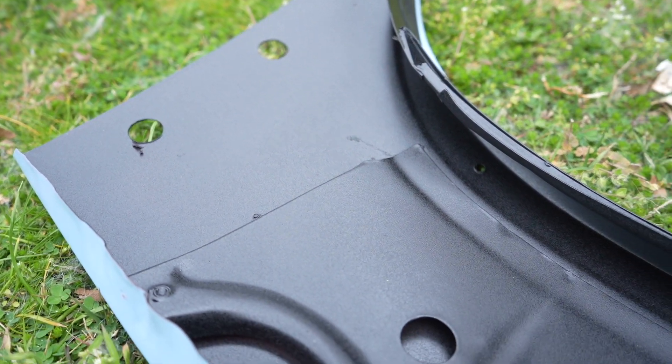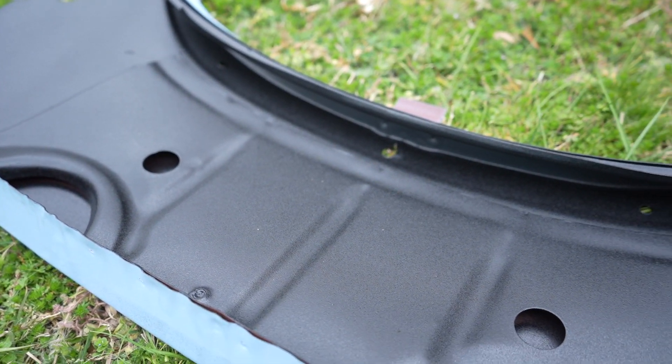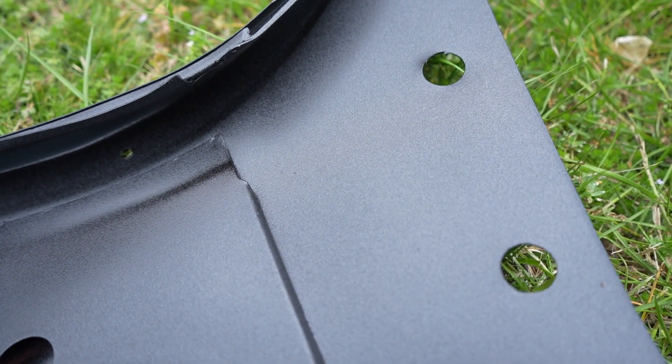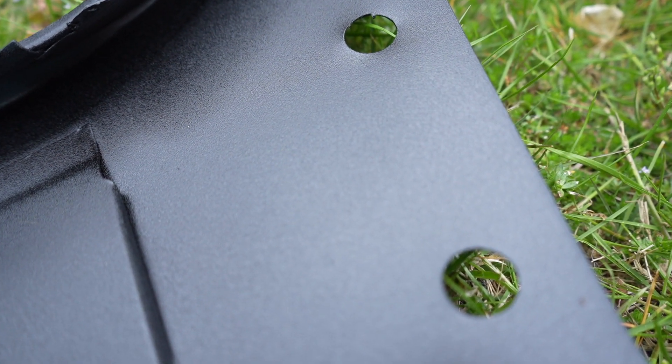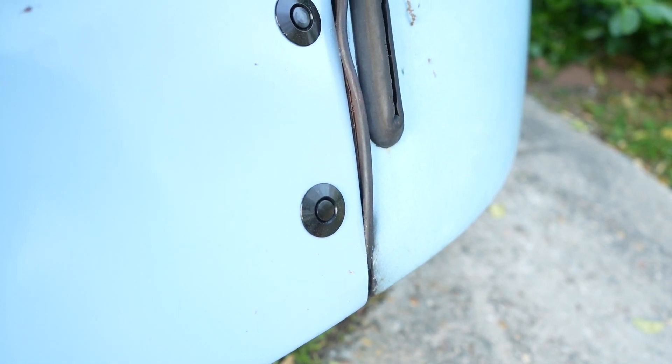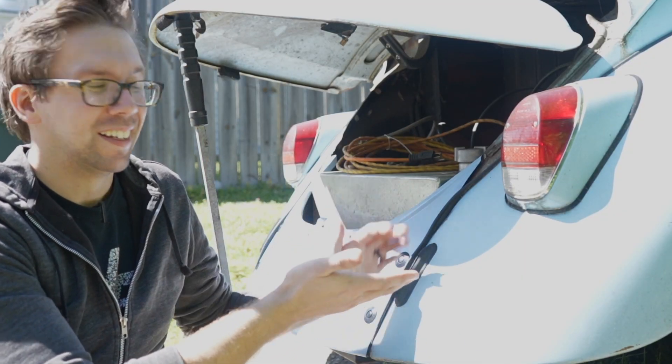For the back of this panel, to protect it from road debris, we're going to be installing Rust-Oleum truck bed coating. Be careful using this in a fender well — the textured particles actually grab dirt and hold it there, which is a bad sign if you've used rubberized undercoat. But on an interior panel or something that doesn't get tire debris thrown on it, it works great — super strong paint. I also like to drill the holes for the quick latches just a little bit wider than needed, because that gives you some play to bend panels slightly and get things over edges.